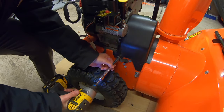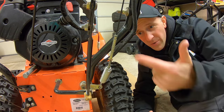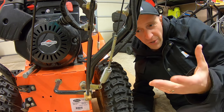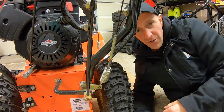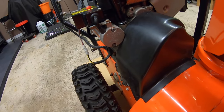One last thing I wanted to show you: if we follow this cable down from the control lever to this bolt and spring, you'll see it's fully adjustable. What you could also do is loosen this bolt, push it down, and then retighten it — that'll create more tension on the tensioner itself. This is just another step you could take, but the main culprit is going to be that tensioner underneath the cover.